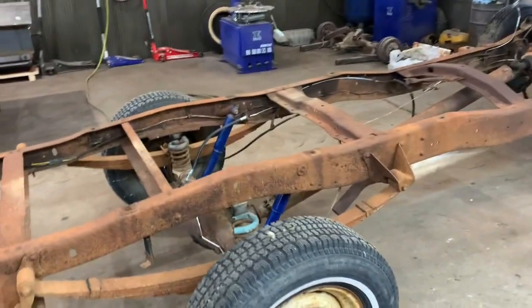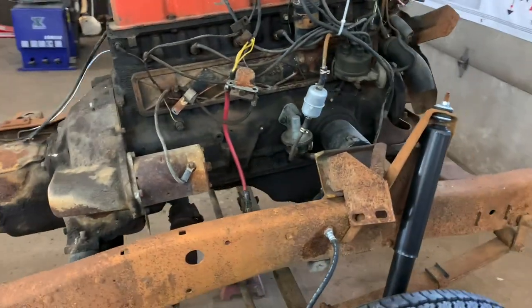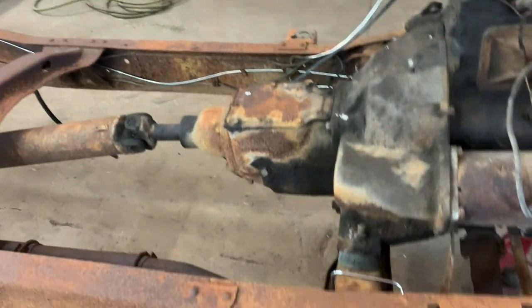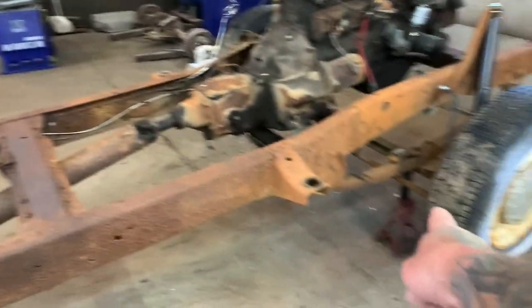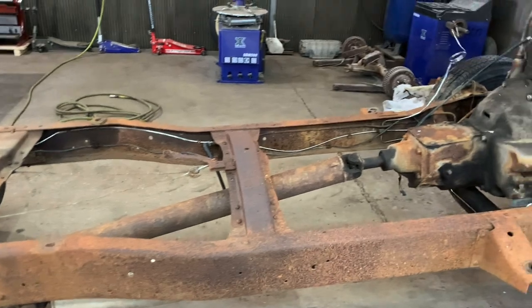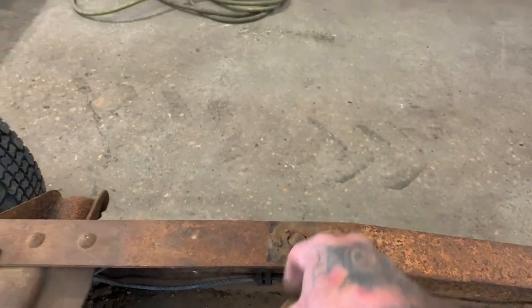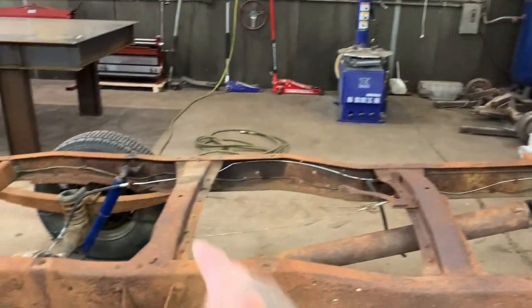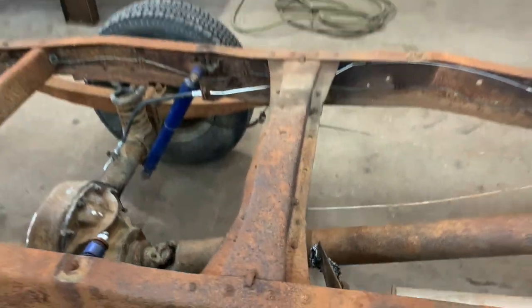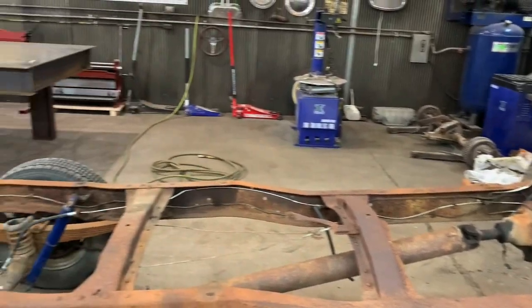I'm going to do this pretty quick - cutting the brake lines, that kind of deal. All the bolts I'm just going to let them hit the floor, I don't need any of them. Some of this stuff is kind of crusty and old and rusty. I'll get the motor pulled out, brake lines, and then the front leaf springs and front end - just going to drop them all together. Same as the rear - drop the rear end with the leaf springs and everything, pull the driveline out, drop the frame on the ground. Stuff like this I'll get cleaned up, knock the bolts out, because when I pulled this truck body off I just cut everything. The cross members - not the back ones, just the center ones - will have to be pulled out. Then we'll mock up the new motor and get the truck sitting back on the frame and build from there.